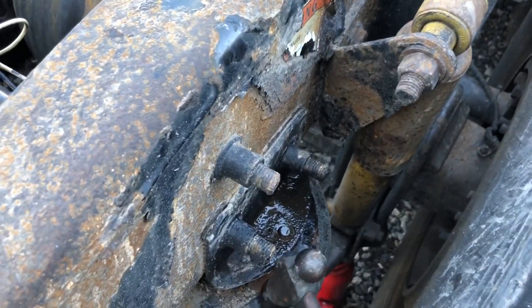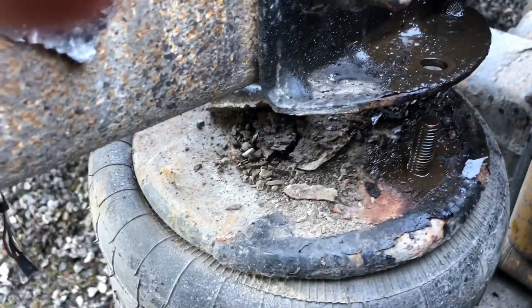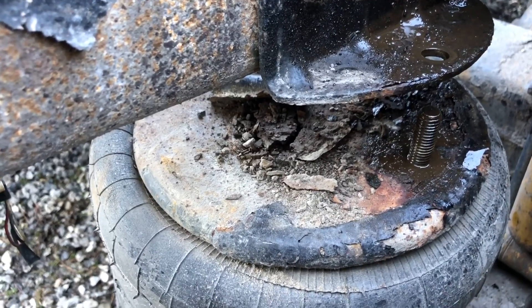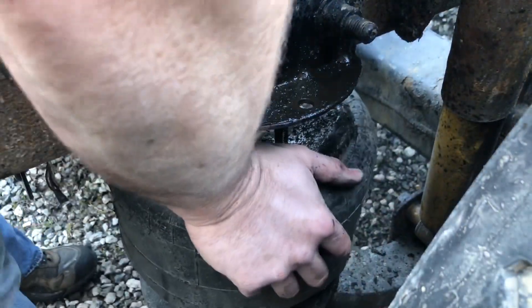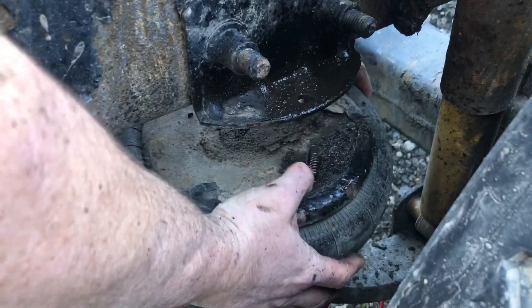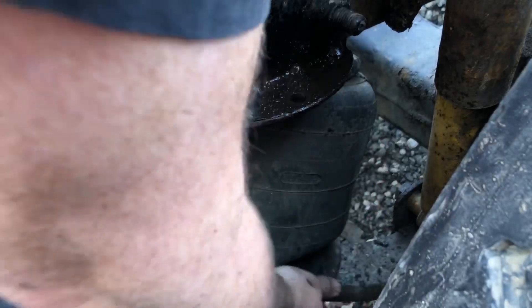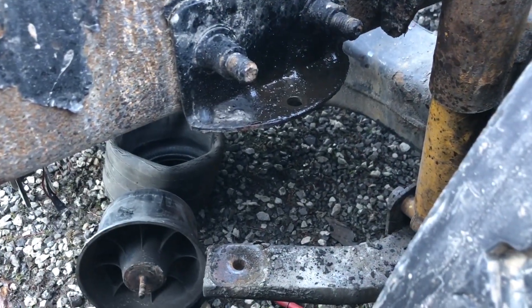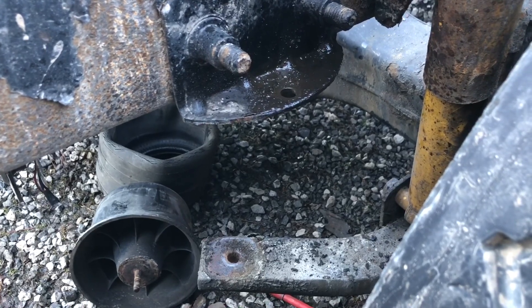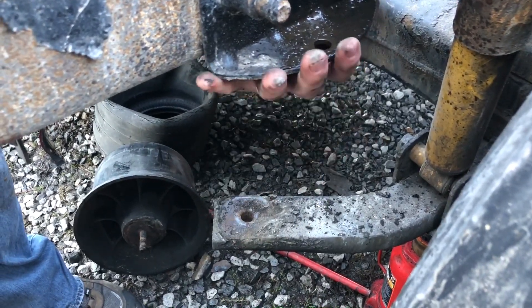Just tap it out — and it's that simple. You see all that dirt — you've got to do a clean-up once again. Basically you're just going to push down on the airbag. You see this little stud — you're going to turn it so it doesn't get in your way, fold it out of the way, just kind of work it out from the front, and there you go — airbag is on the ground. Now you want to make sure you clean this whole section off on the bottom and on the top.